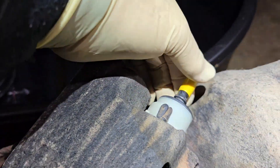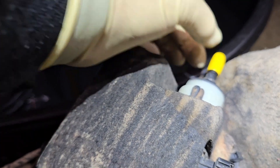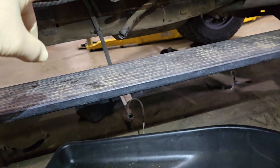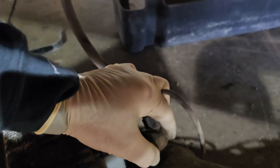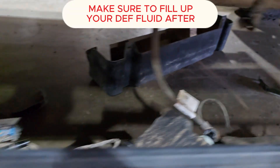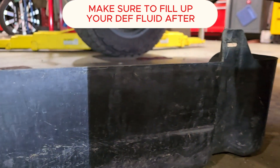Put a slight amount of lube around the nipple here — but make sure it's not near the edge — and also around the vent so it slides on easier. You may also want to blow out your bulkhead above the frame rail so that connects easily. Slide the tank under the truck, connect the DEF line and the connector first, then slide it forward and lift it up to connect the vent. Then put the straps in to hold it in place — slide it up until those holes engage in the front and rear clips.